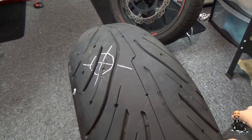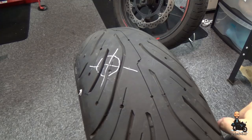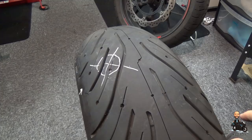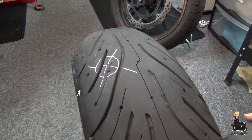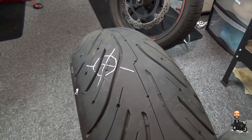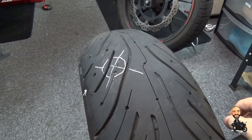Now that's important - to get that sealed you've got to do a correct seal for the hole itself. Because if you don't, there are lots of metal bits, cords running through the tyre that give it its structure. And if those break, water can get in through the hole. Those can get rotten and then the tyre can be damaged structurally, and then the first thing you know about it is when something really bad happens. That's even the case with a patch repair. So people say that if you take the tyre off and do a patch on the inside, that's a good repair. That doesn't count either for the rules, because it doesn't fill the hole. So you might have a patch inside the tyre but there's nothing in that hole, so water can still get in and can still rot that metal. And all that's kind of important for safety.